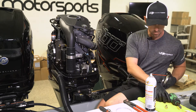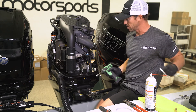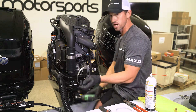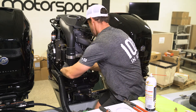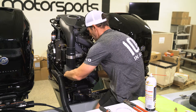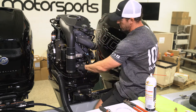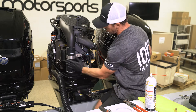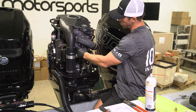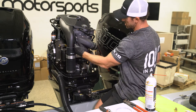I did leave the clamps off for a reason — I like to have the clamps off and position them once I have it all together. That way I know which way I'm going to put them on. I personally like to line them all up the same way. So I go ahead and put it on and screw it on like so — that's why the snap-on comes in handy. Once you put it that way, you can get the clamp exactly where you want. You want it on the inside, away from here, so that way the cover will clear. The second one will go right above it, and the third one will go in the same line so it looks nice and clean.